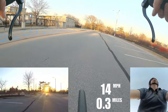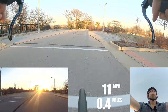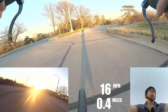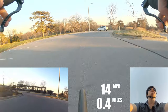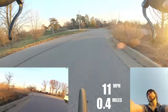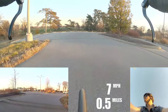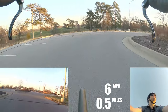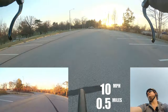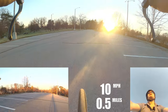Kind of slow, fast, slow, fast. So let's go fast. We're gonna slow down. I'm gonna go fast. Now maybe I'm expecting too much from this sensor, you know? Maybe I can't even remember how accurate my wired magnet sensor was in the past, like how quickly it reacted to movement. I would imagine just as quick as we can register the magnet. You can get a magnet sensor from Wahoo. It's called the Blue SC or something. This is the Wahoo RPM though, which uses an accelerometer, a spinning hub to measure speed rather than a sensor fixed on the bike and a magnet passing by it.